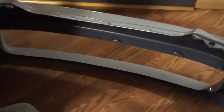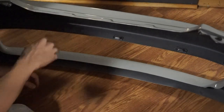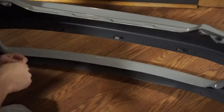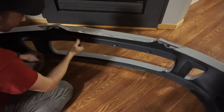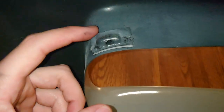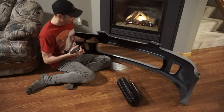When we flip the bumper around and take a closer look, you can see there are tabs on the top and bottom of this big opening. Those are usually meant so you can screw something into them, but this is ABS plastic and it's pretty thick, so the little screws I had weren't sharp enough without pre-drilling holes — and I didn't really want to go through all that. So what I'm actually going to do is drill holes through these little raised tabs and use zip ties. I already drilled out one of the tabs as an example — I used my Dremel tool to grind away from the front all the way through the back of the tab, leaving the top intact, which allows a zip tie to slip through there. Once we have the mesh held up, the zip tie will go through the mesh as well, securing it tightly to the bumper. So now I'm going to do the same to the rest of the tabs.